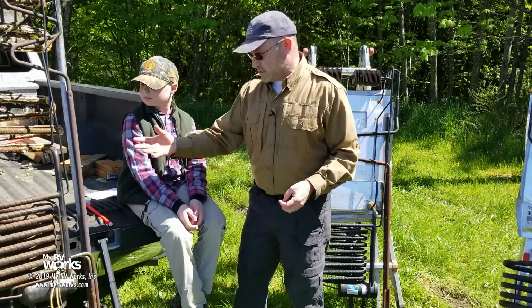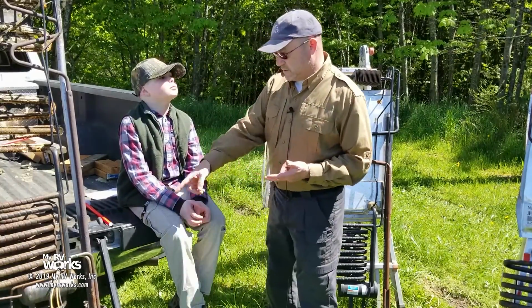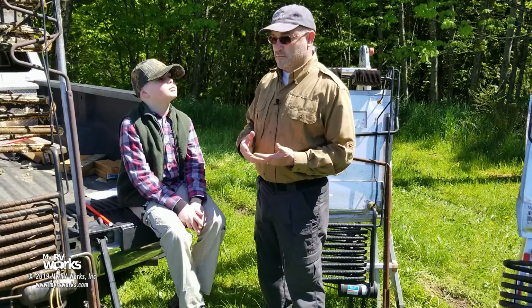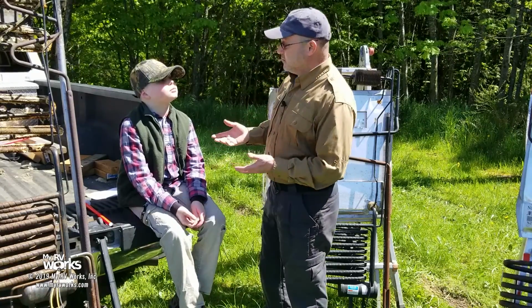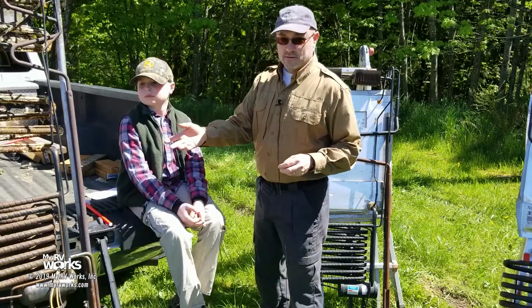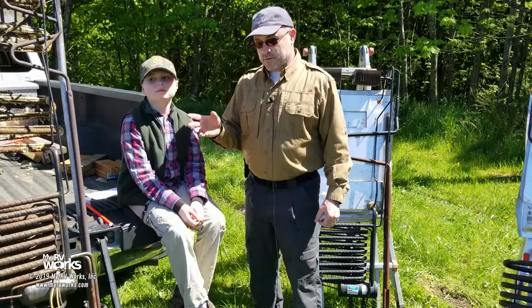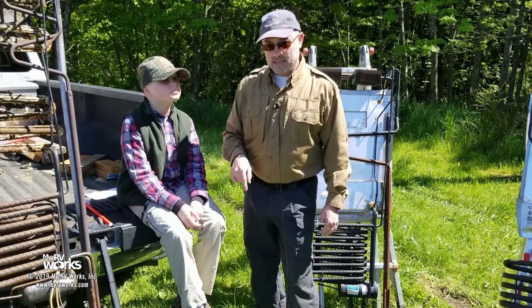That's it. You apply heat. In our RV refrigerators, I keep pointing to this one, heat is in the form of an LP or a electric heating element. But in other places, in industrial settings, heat could come from a solar array, heat could come from waste products from an industrial process. Like I said, on the International Space Station, they're keeping their beer and their ice cold. They're keeping their Kool-Aid cold and their milk cold, but they just need to apply heat, probably from the sun. And their water, they want to have cold water. So with all that being said, you just apply heat. Once your chemicals are in it, it's a sealed system. Once your chemicals are in it, you apply heat and then you get cold.